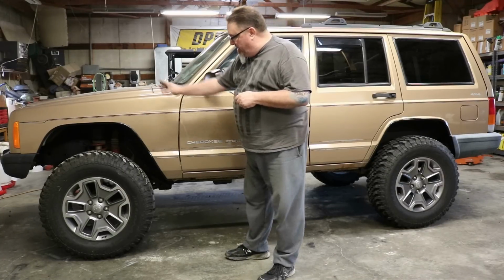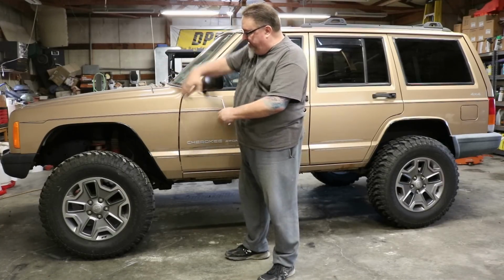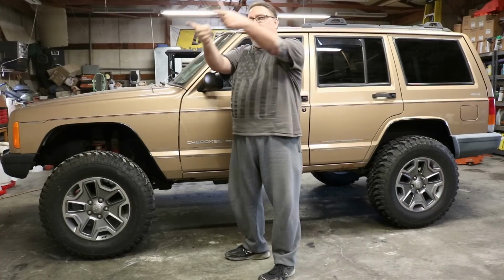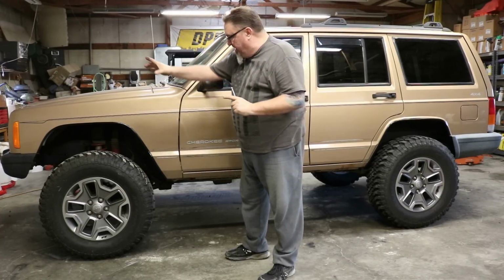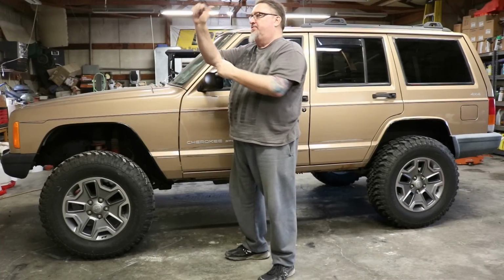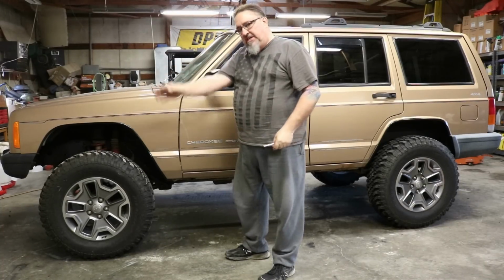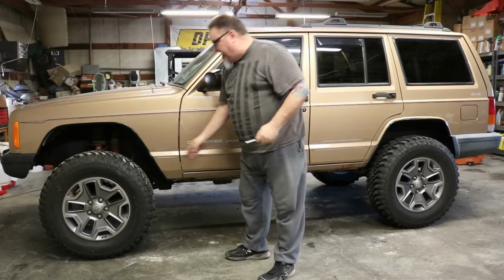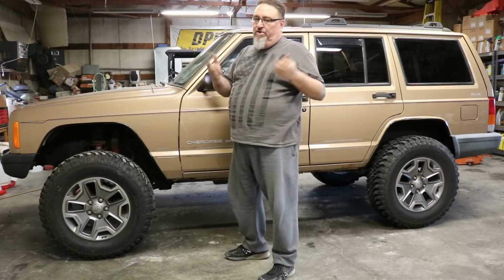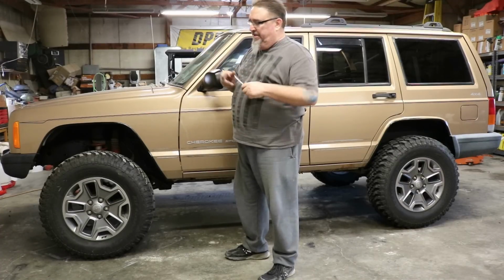Once it's in there and setting where I want it and kind of shaved into place, I would just take some black polyurethane sealant and run a bead down each side of the tube in the fender well, and I like to just push it in there with my fingers or thumbs and set it so that it seals that foam tube inside there. Again, completely optional if you want to. I kind of don't do it anymore. I just don't really see a benefit there.